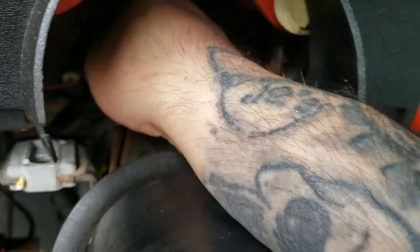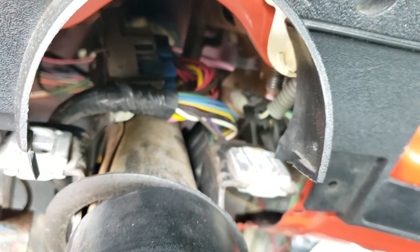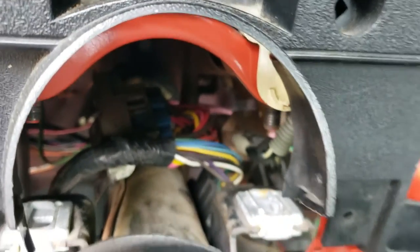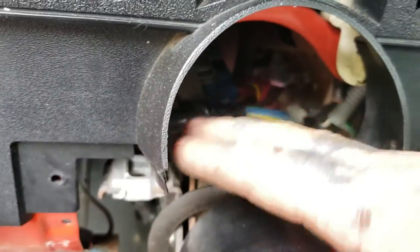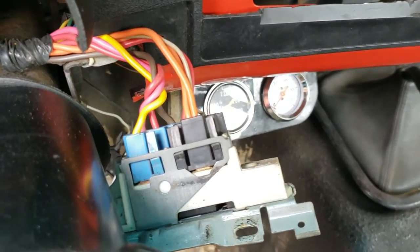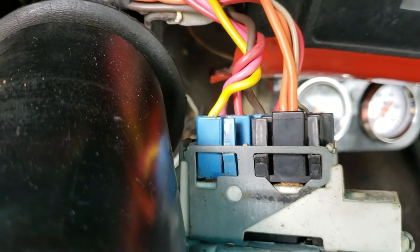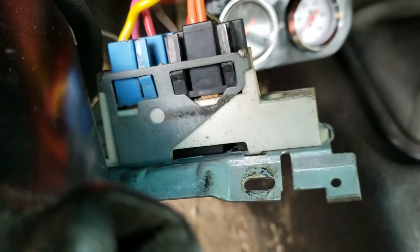To change it, you've got two five-sixteenths bolts on the side right here — two little tiny bolts. Loosen them up, then come in here and pick straight up on that and it will come off this rod. You can see I've got mine loose. Just do that and you can pick it up, move it out of the way enough to unplug it. Even though we work the key, nothing happens up here, because this rod has got a notch that this sits in and that notch works the column. Let me show you with a screwdriver.